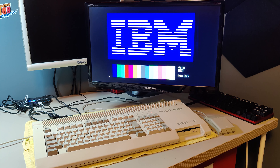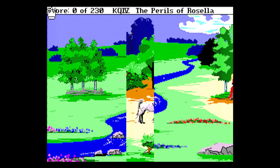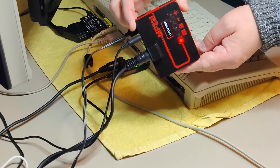I will use my beloved Euro PC for these demonstrations. I have installed an XT-IDE in the only ISA slot, and I have replaced the 8088 with a NEC V20, so it's about 30% faster than stock Euro PC. The Euro PC supports Plantronics graphics, so that means we will get 16 colors even in CGA.